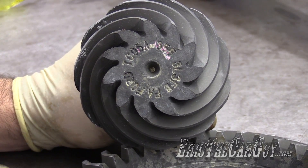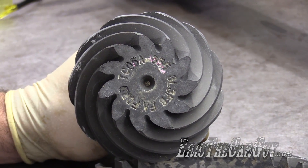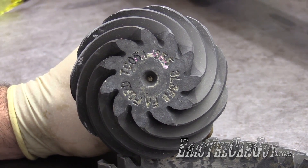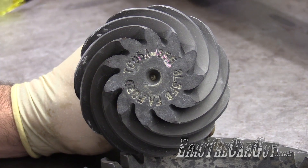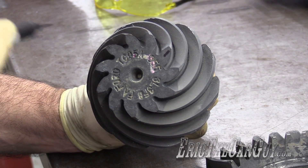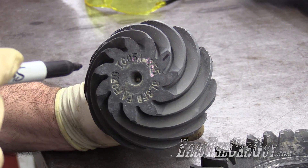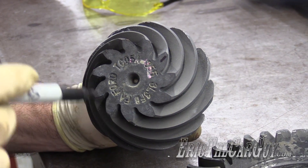Now let's talk a bit about gear ratio. As you can see printed on the outside of this gear, it says 355. But what if it's not cast into the outside? Well, there's an easy way to find out what gear ratio you have with a set of gears. With the gears out of the vehicle, it's actually pretty easy and straightforward. You've got to count the number of teeth on the pinion and the number on the ring, and then divide the two.